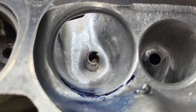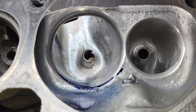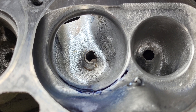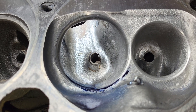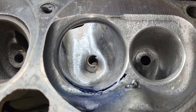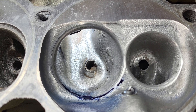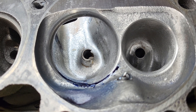Just wait till you see what the swirl did — that surprised me. I never really had the wish to make this a straight port; I think the bowl is too deep and it's not really designed for it. It might work if we filled a good part of that bowl with clay and then flowed it — that's an interesting thought. Give me some feedback if you'd like to see that. I need to get on those open-chambered DV heads — running out of time on that — and I want to try a couple of ideas I thought of recently.